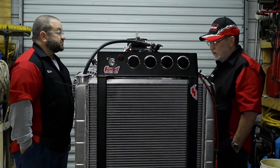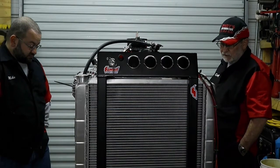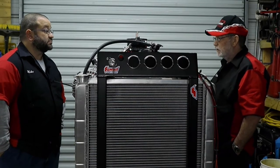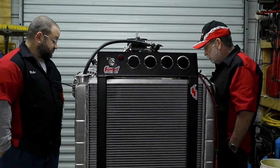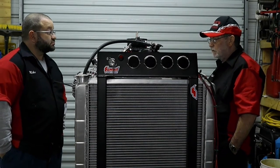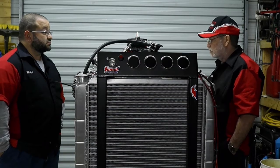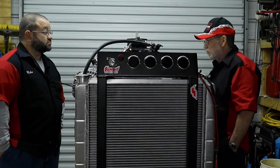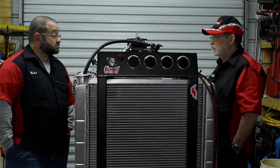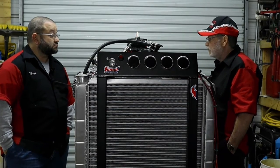The test stand itself comes with a tray in the front where we've got our battery sitting and a five-gallon bucket to catch any coolant if it overflows — which it never has. We put a two-gallon aluminum fuel tank on it, which is enough to run 20 minutes or so at idle plus some throttling to see how the motor actually sounds. I put an electric fuel pump on it as opposed to a mechanical fuel pump. You can really do just about anything you want — it depends on your plans. You can leave it full mechanical without all the fuses and such.